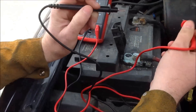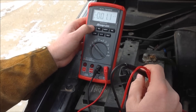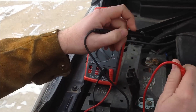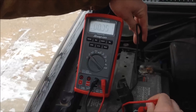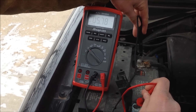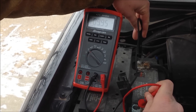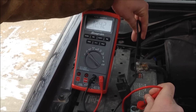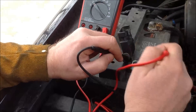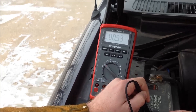What we can do is actually measure the volt drop across that connector. Leave your meter in the same setting — let's get this off auto-range, makes it a little easier to read. We've got volts DC. We'll go ahead and get a stable check on the battery itself again. Come on — even getting a good connection on the battery itself here is giving me a problem. There we go — 12.4 volts. Now I'm going to do an actual volt drop check across the connector, going from the terminal to the connector itself.